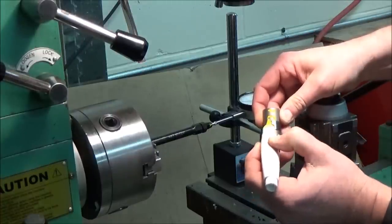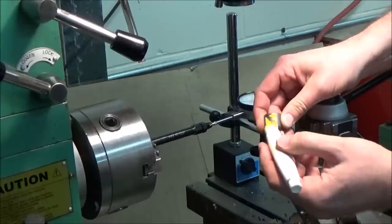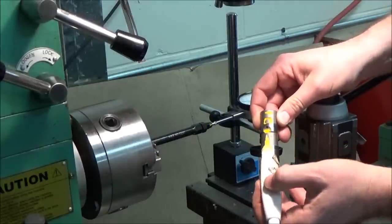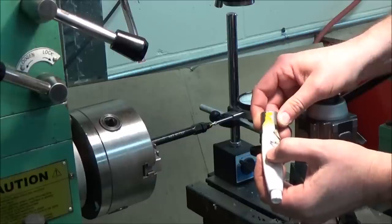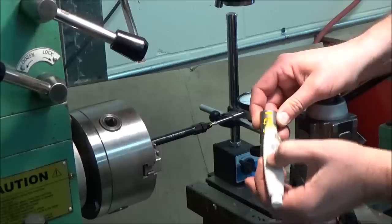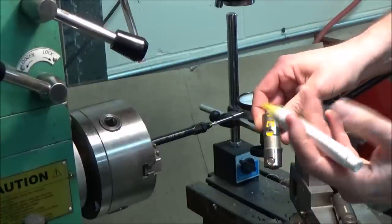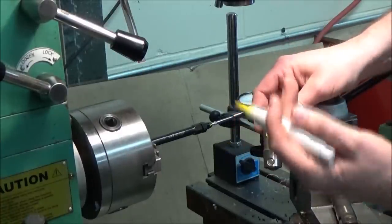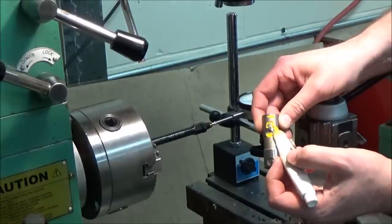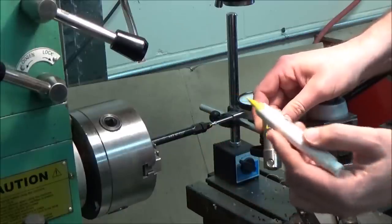What we're trying to do with the adjustable pushrod — do you remember from class how there's a piston in here? We're trying to put that piston right in the middle. That means when the bike starts up and has to push oil in here to pressurize it for zero lash — the whole point of that hydraulic lifter — we don't want it sitting right towards the edge maxed out, and we wouldn't want it all the way at the bottom either. We want it to float on either side, so as the engine gets hot we won't have a tight valve that hangs up, and as the engine is colder it's not going to be so loose that it can't tighten up.